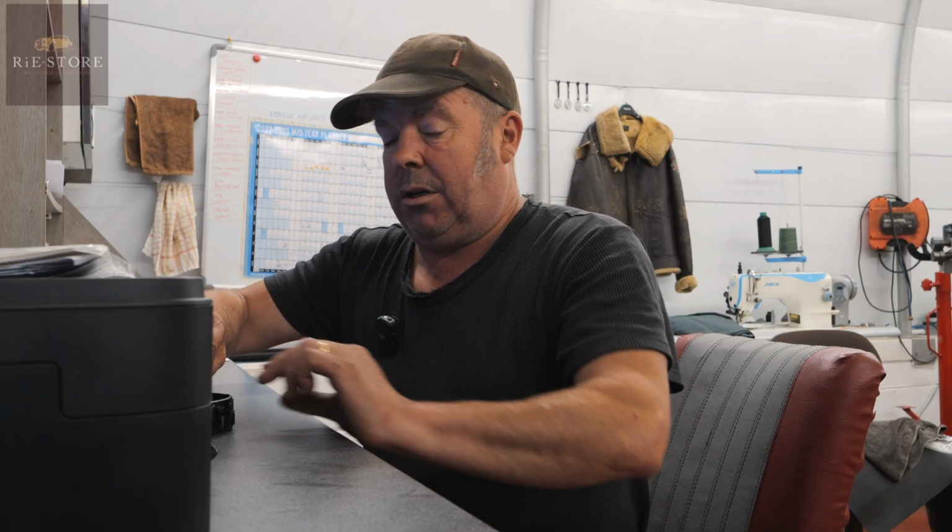And as for the tightness of the clutch, as long as you've got the lock tab washer on there, don't ever put thread lock on that, because they're an absolute pig of a thing to get off once they've had thread lock on them. If you've got the right socket, brilliant. I would torque it to probably 20 foot-pounds. I wouldn't go any more than that, because it's got a lock tab washer. You haven't got to crank it to death, you know what I mean?